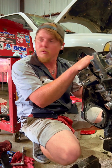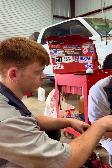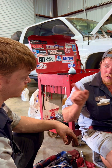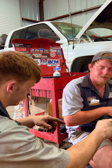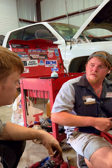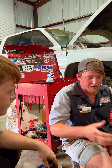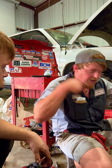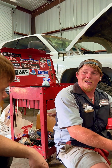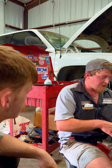So on this one, tell me what you've done. I set the motor at TDC using the timing marks on the crank and cam gear. But what I tell you — you got to break the nut loose on the thing before you set the pin. You got to break the nut loose first, so that you're not going to break your tab. If you hold the engine with that timing pin and try to break the nut loose, it's going to break that timing pin inside the engine. So you break it loose first — it's not going to slip timing yet.